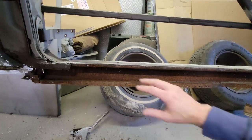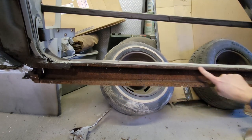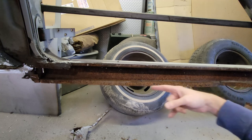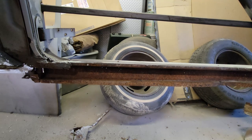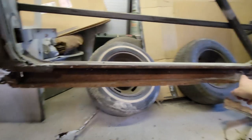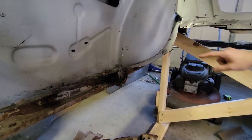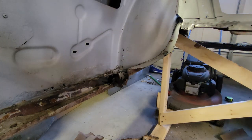This side was just as bad - nothing was attached, just a couple of welds. The edge of this rocker panel is like brand new except the bottom. I guess they didn't weld the bottom because it was corroded on the inner rocker panel, and they didn't weld the top because they were lazy. This thing is being eaten alive - there's light coming through here, and here, and back over here. So now I've got to come up the wheel well on both sides and get the section in between the two wheel wells out.